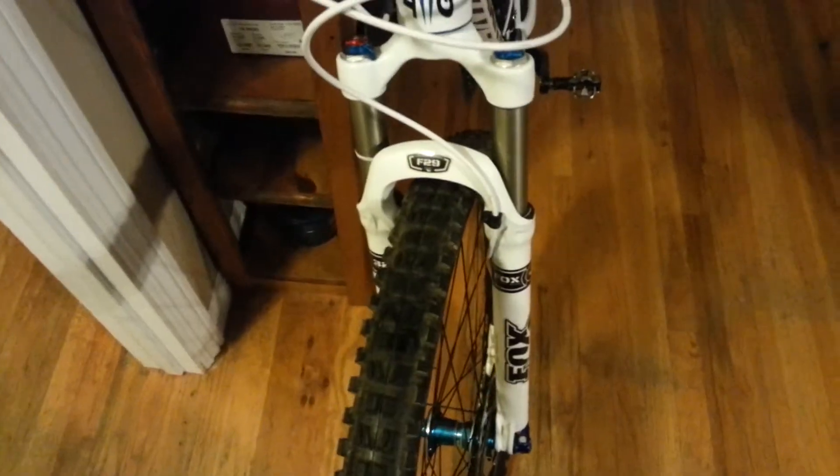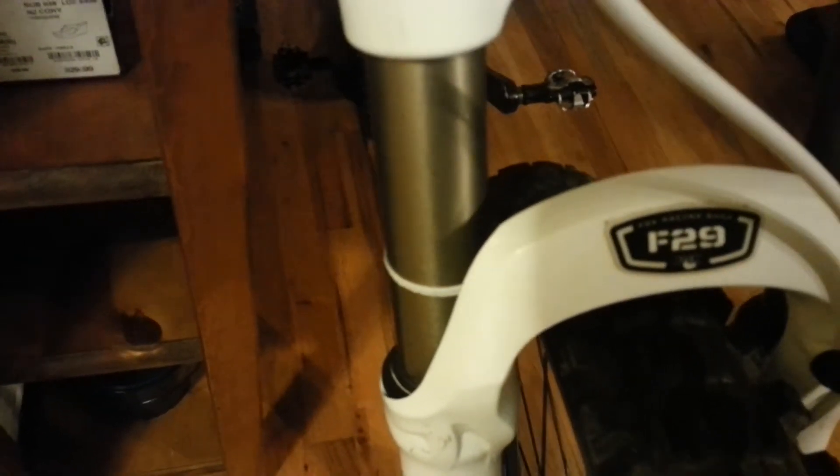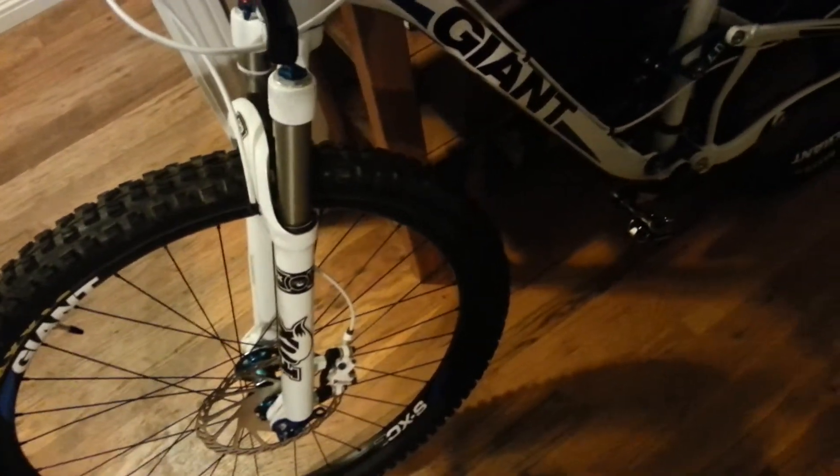Play around with it, but again — can't stress this enough — don't play around with it without a shock pump or you'll be stuck. By getting more travel and getting that indicator up around 70–80% on your bigger trails, your bike's going to perform a heck of a lot better. A lot of people with their travel indicator too low are complaining they need a longer-travel bike, when really they just need to let some air out.